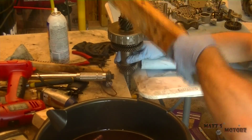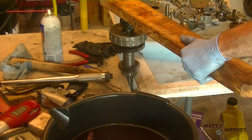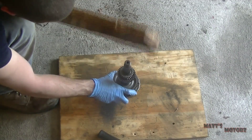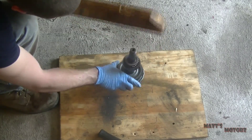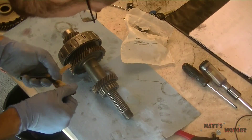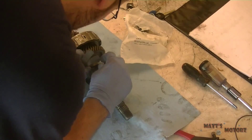Then the spacer hub, and now I'm going to hammer the shaft back on. I did this for a while, but it would get almost all the way and just stop, so I eventually had to take it off between two tables and smack from the top the rest of the way down. I hit each side the same number of times to drive the gears down evenly. Now I'm going to check the clearance between the sleeve to make sure everything is in the right location — just using my feeler gauges to get the clearance.